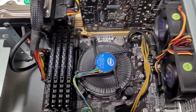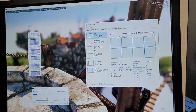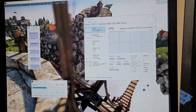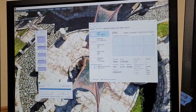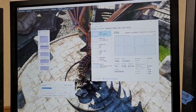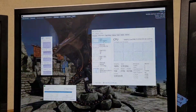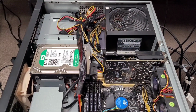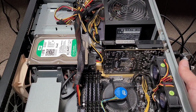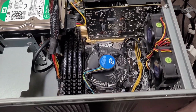So, yeah, we're going to have to just live with high CPU temps, I guess. I am beating on it pretty hard right now. I have FurMark CPU burner doing stuff, and then I have a benchmark running. The CPU's pulling 68 watts, or around 82 Celsius. Not so great. Looks like I am turboing a little bit. But yeah, I'm gonna run this with the cover on for a bit before I go home, and hope for the best. Hopefully no more blue screening.